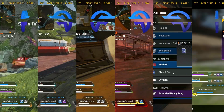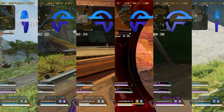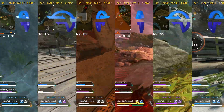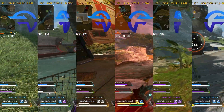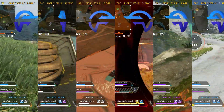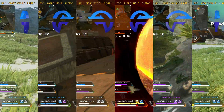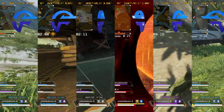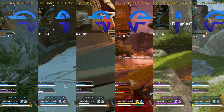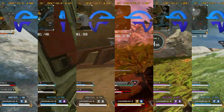So there's a lot going on on the screen here — if this bothers you or you're going to have a seizure, you can just skip over to the next part. But this is all six of the voltages that I used and their maximum stable frequencies that I could achieve. You can watch and go through them, and also the corresponding power draw of each of the voltages. Feel free to pause the video. What I did was I went to GPU-Z and took the average power draw of each run, just because there's so much fluctuation in what you're looking at in the game. You have to use a program like GPU-Z to take the average of the entire gameplay run.